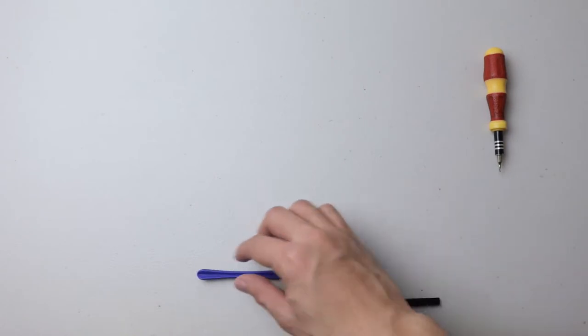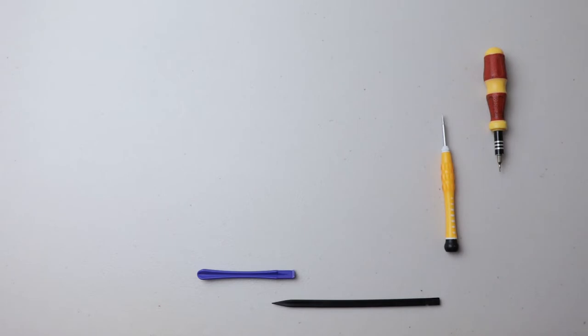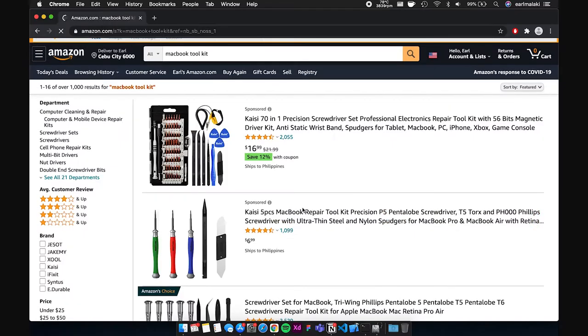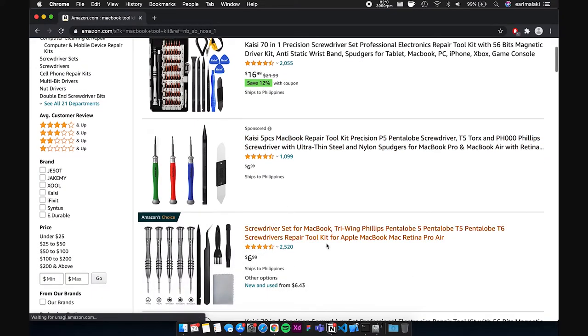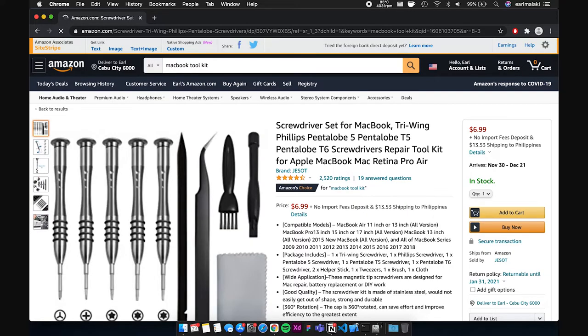Before I cover everything on the process, let me quickly cover the prerequisites. Number one, the tools. In my case I've got a MacBook Pro. First, I need a P5 screwdriver to remove the screws on the back cover. I also need a plastic spudger to remove the battery connector, and lastly a Torx T5 screwdriver to remove the SSD screw that holds in the SSD. You can buy a MacBook toolkit on Amazon for $7, and this package contains all the tools you'll ever need for any DIY fix on your Mac.